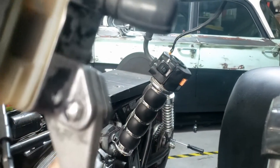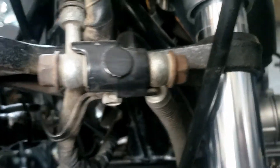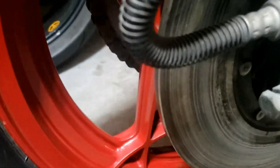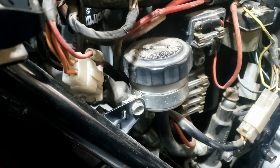Here's the brake - the leaky one - and that comes down into a join mounted onto the front of the bottom yoke. One goes down to the front piston because there's only one disc brake, and the other one tees off and goes somewhere I don't know. I'm looking forward to finding out where that goes when we take the tank off, because the rear brake has its own little reservoir. So where does that other hydraulic line go? I think we need to get this tank off sharpish.